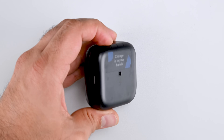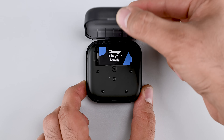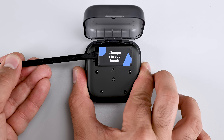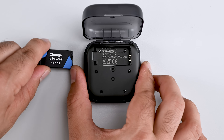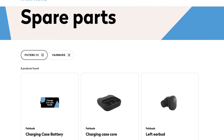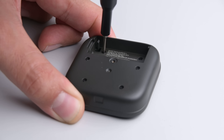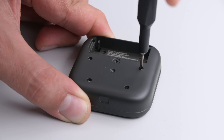And that's it for the buds, but we still have the case. The case has a single Phillips head screw that gives us prompt access to the 1.85 watt-hour battery. Just like their phones, Fairphone offers replacement parts on their website including this battery, which is something we wish more manufacturers did. We can remove the outer shell — another component Fairphone sells in their store — and we now have access to a few more Phillips head screws.